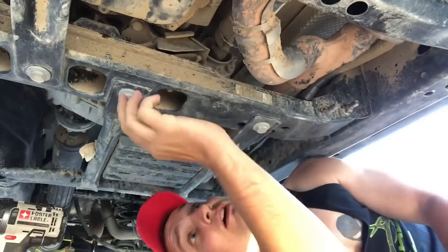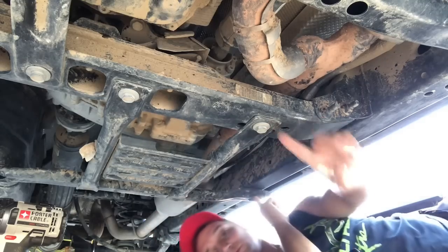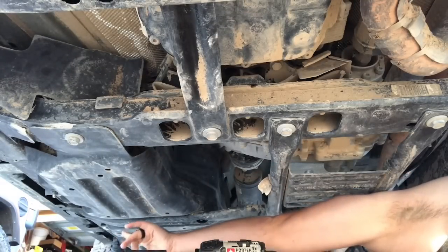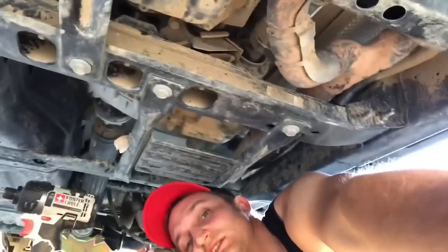All right, guys, we're under the transfer skid right now. It's gonna be the first thing that comes off. I'm gonna wanna take out this bolt, this bolt, this bolt, this guy, and this guy, and that guy. And it should drop out. We're gonna be using 13 and 18 mil sockets.